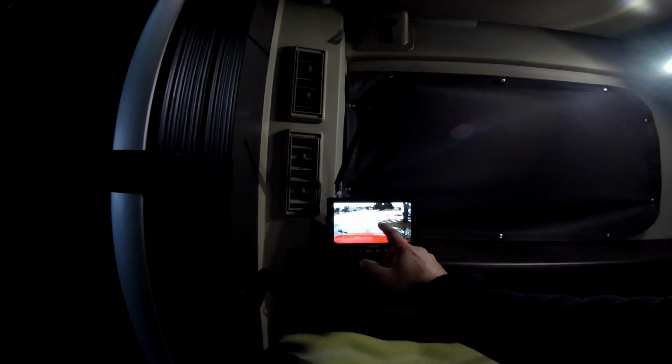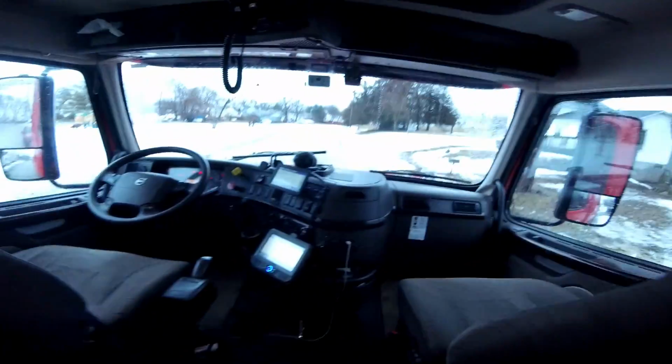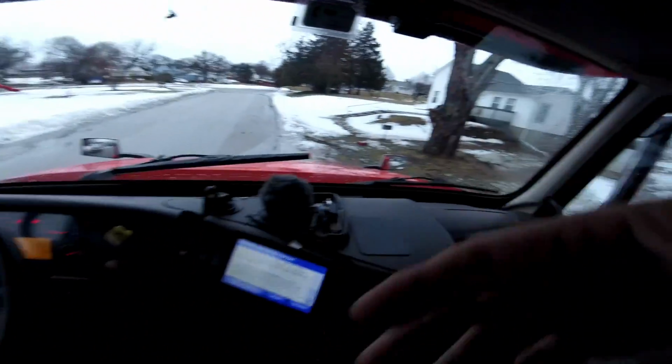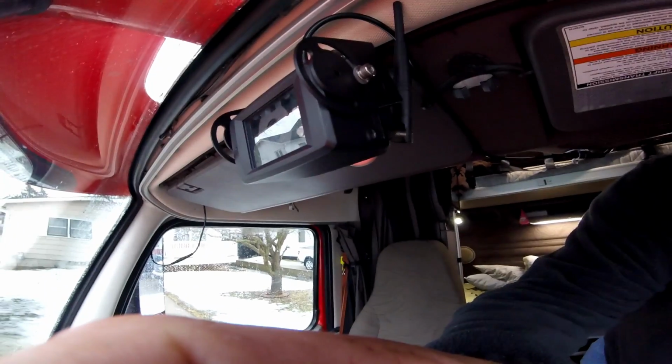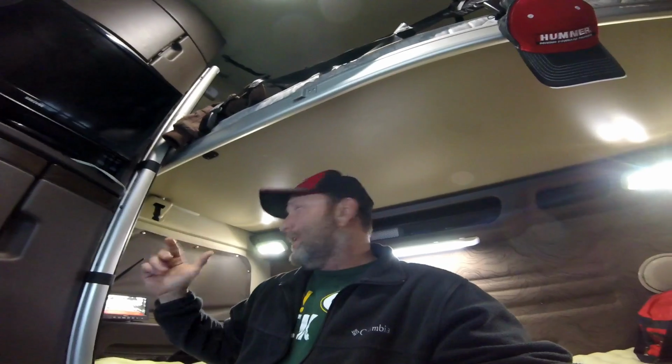One other thing that I have got to absolutely just thank Haloview for. One issue that we were having with this camera was the front facing camera. I'll tell you why. On the front of these cameras, I'm sure you can see those little infrareds there. There's four infrareds, 2 on one side, 2 on the other side. At nighttime, shooting down the side of the trailer, amazing. They're absolutely amazing. They say a 35-foot range, but I'm gonna say more like maybe 50 to 60-foot range, because I can see all the way down the side of the trailer in pitch black with the infrareds on these outside cameras.